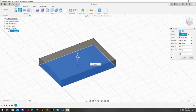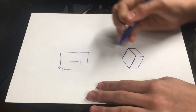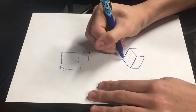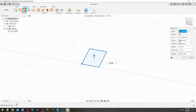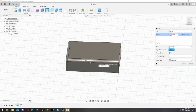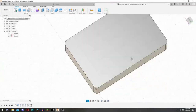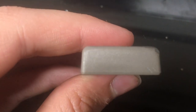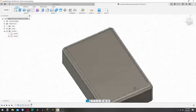I started by sketching out the piece on paper and measuring the width, length, and height, then took those measurements into Fusion 360 and modeled out the new piece. Fortunately this model isn't too complicated — it's basically just a rectangle with rounded edges. The original piece did have a slight slant to the side and was also hollow, but I decided it would be too time consuming and not 100% necessary to add those details, so I left them out of the final model.